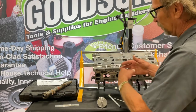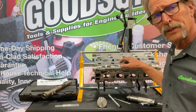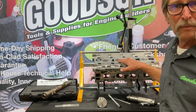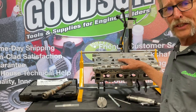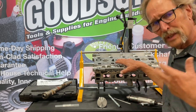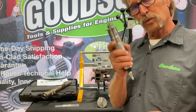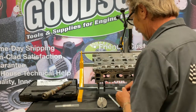It's really a task-saving, time-saving tool, because disassembling and reassembling and machining these components to get that cam lash right really chews up a lot of your time. From customers who already have this tool, they're able to save an hour to an hour and a half of assembly time. If you're doing four of these cylinder heads a day, you can add another three hours — that means you can get one more head out per day, and once you get into the routine you might be able to add two more. The investment is certainly worth your hard-earned money.